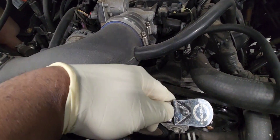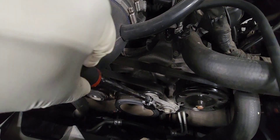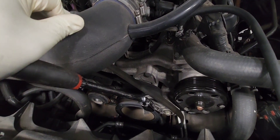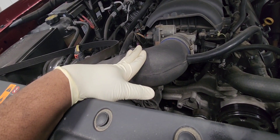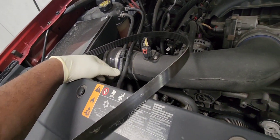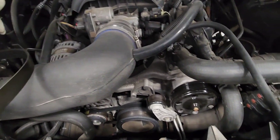Let's start by removing the drive belt. We're gonna use a half-inch ratchet to remove it. The half-inch will go right there on the tensioner to relieve the pressure of the belt. Remember the belt routing before you do this, by the way. Take the belt off. This vehicle has a cold air intake, so I didn't have to remove the air intake. But if you have to, it's 8mm over here on the throttle body and an 8mm to the airbox — you just pop it off. Take out the PCV hose; there will be two PCV on the back on each side, you just pop them off. On this one I have enough space to work.